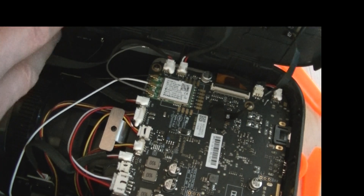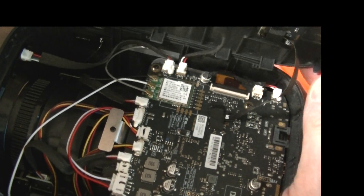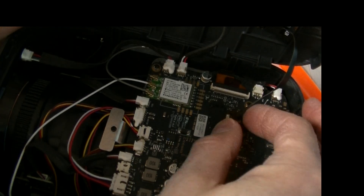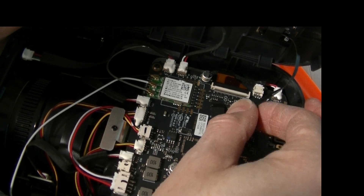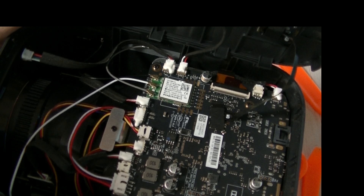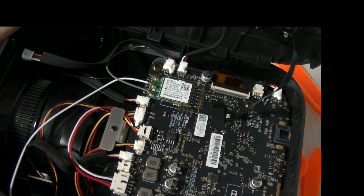There was a very fine, almost imperceptible gap between the case and the top. I wish I had known that is the way to get inside. There are two cables running from the top to the logic board — one is to the on-off illuminated button switch, and the other is to an infrared sensor, probably for the remote. One or both of these cables will have to be released to go any further.